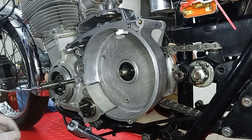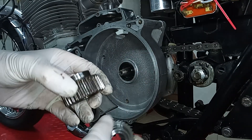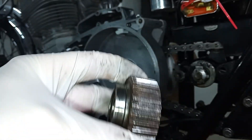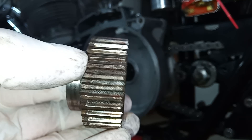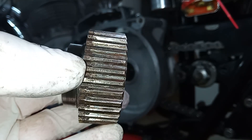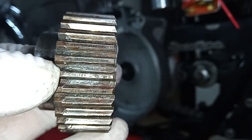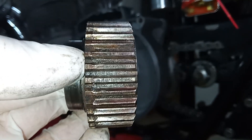The next thing we're going to do is fit the clutch hub on the shaft. Here we have the original clutch hub and here's a new clutch hub. Now, these splines are very slightly worn. If you look where my thumb is, you can see the unworn part of the splines, and then from about the light spot onwards you can see how those splines are worn and how thick they should be compared to how not thick they are — it's beginning to wear. When it begins to wear, that wear will accelerate very rapidly, so it's definitely time to change this clutch hub.